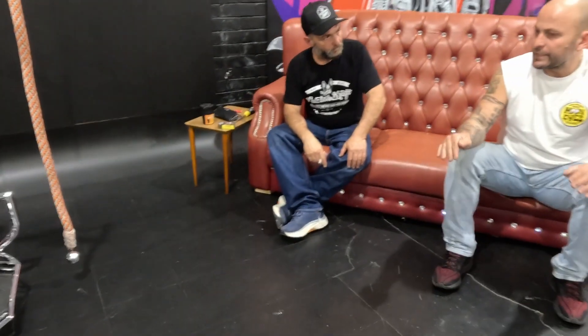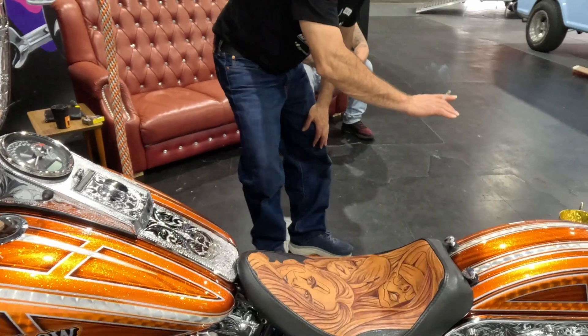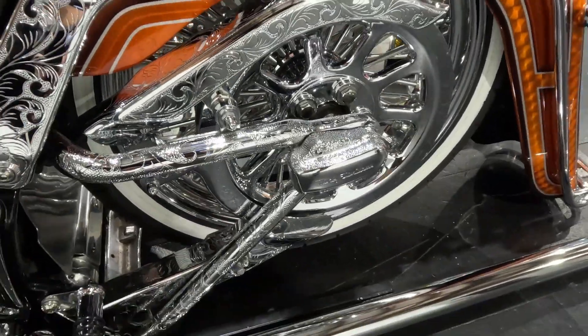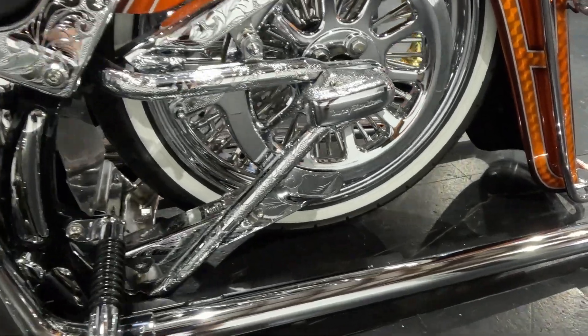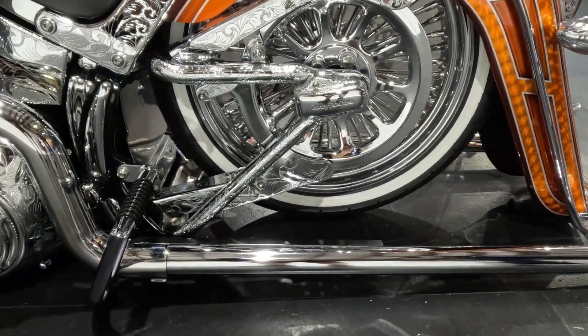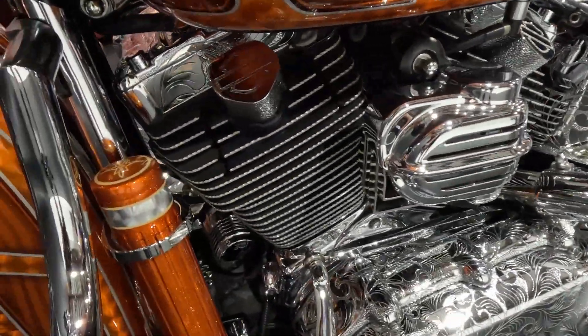It would obviously take a bit of air to lift the bike and operate that big system. You've got to run a relatively high pressure because from being on the ground with the modified angles, it needs a bit of force to get it started. Not only have you got that swing arm all the way up but it's tucked up — extra air is needed to get that arm to come back down and push your bike up. You can see now that it's parked with my belt guard — I've got clearance between that and my final drive. When the wheels are on the ground I do have clearance.